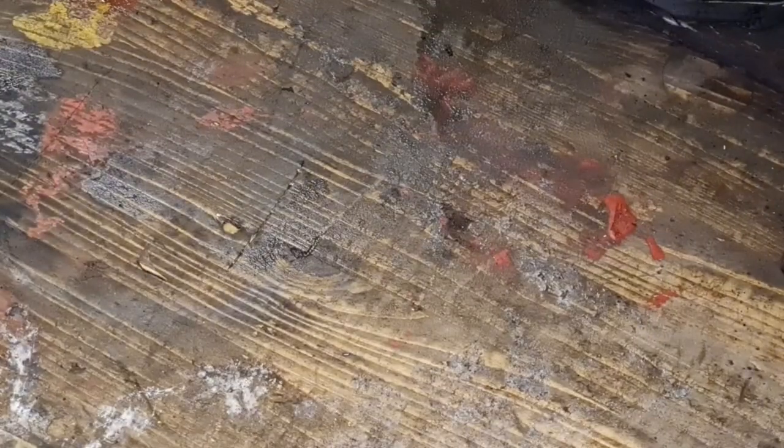And like I said, do not overtighten these. See, there is a nut there, but they put a flat screw in there, really so you don't overtighten the damn thing. You only want that as tight as you can get it with a screwdriver. If you start going any more, you're likely to distort that paper. There you go. That's about as tight as I can get it with a screwdriver.